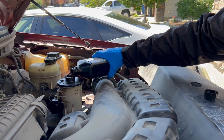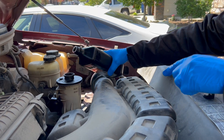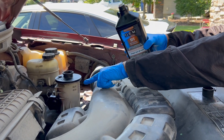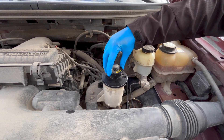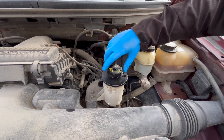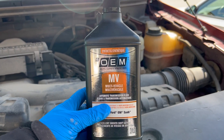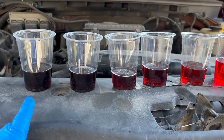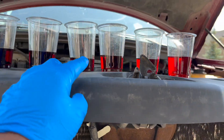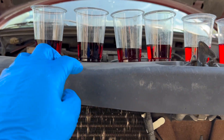The reason that new oil is added, then circulated in the power steering system and removed, is that this is the only practical way to remove most of the old fluid. By the time the reservoir has been refilled four times, there's mostly brand new fluid in the system. You can certainly perform this task a few more times for good measure, but be sure you have enough power steering fluid on hand. Here's a great comparison of where I started off and all the different stages of adding new fluid to the system.